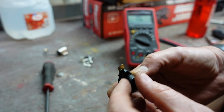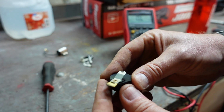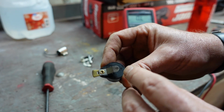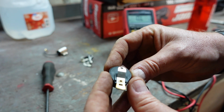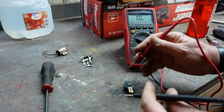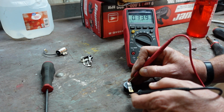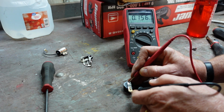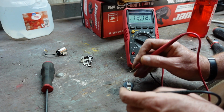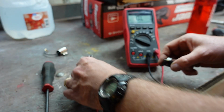The other thing you can see, at least I hope you can, is some schmutz on the rotor here, but it's not pitted. It doesn't really look that bad. So I'm just going to clean that stuff up, but I don't expect any problems there. I'll take a resistance check between that black dot and here. And yeah, I'm getting 0 ohms there pretty easily. No, maybe not. Hold on. Yeah, I got 0 ohms there. So I'm just going to go ahead and clean that up.